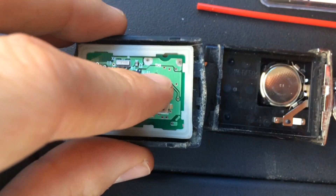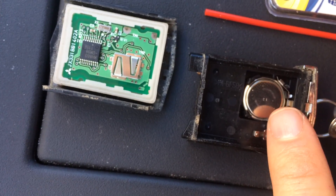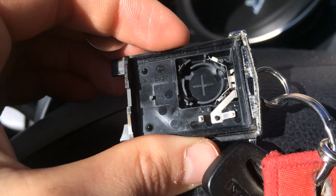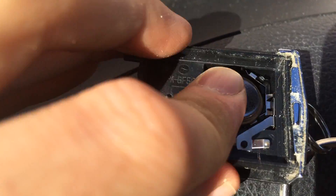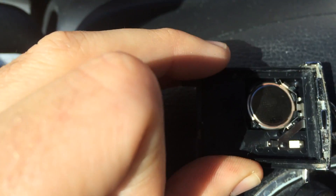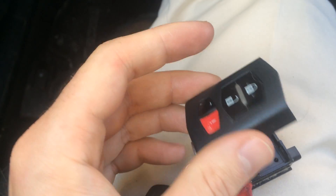Notice that this is the key fob compartment, and I'm holding the buttons into place, but they're a loose fit. This is your CR1620 battery. Now that this is open, you can see there's a giant plus there, so you want to install the battery positive side first. Push it in — there are two snap tabs on the sides and a third one on the front. And there it is, clicked in. You want to align the battery clip on the circuit board with the battery; that's how you know you're back in the right direction.